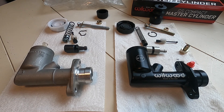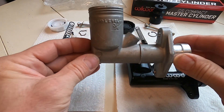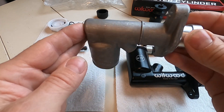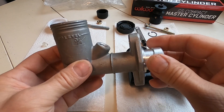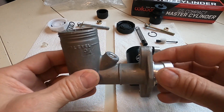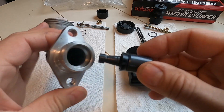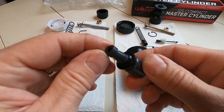In smaller bores, these are three-quarter inch bore cylinders. They're a single cylinder, single reservoir master cylinder — they're not a split system like modern cars with split front to back; you just got one circuit. I've had a little trouble with these master cylinders. They're a reproduction and you'll see them sold on Amazon, but I bought four of them on eBay. They seem to be pretty well made — machined well and they look really tidy — but I've had trouble with two of them leaking past this seal here on the piston, and they end up leaking out the back of the master cylinder.